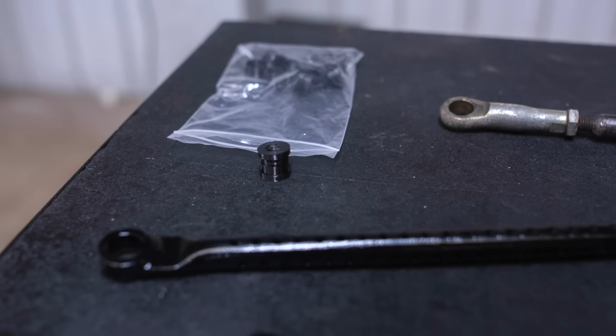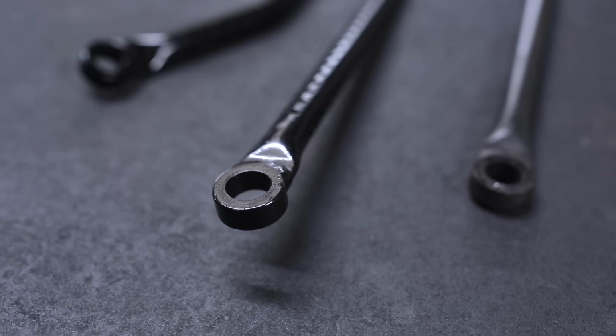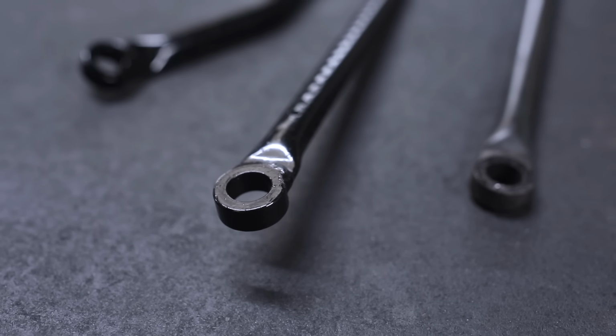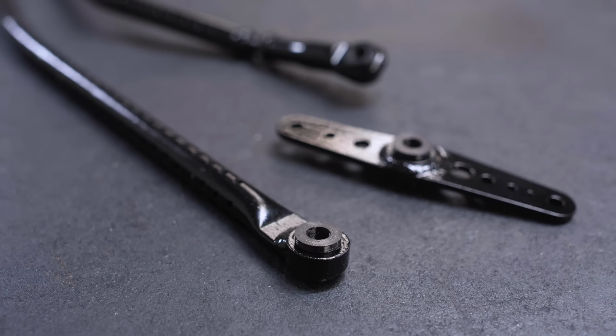The gear linkage bushes are firmer than the originals, but not solid like some kits. That's because the solid mount kits are said to transfer too much harshness and vibration, and each pair of these bushes interlocks as well.